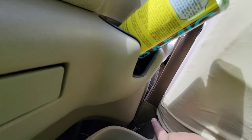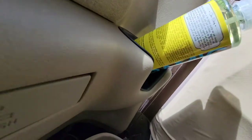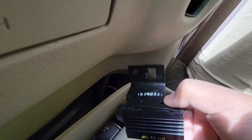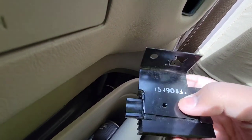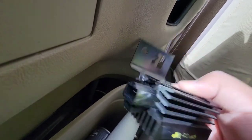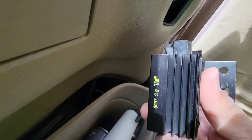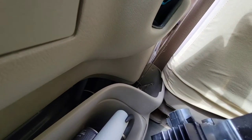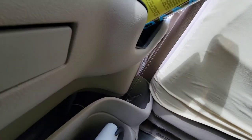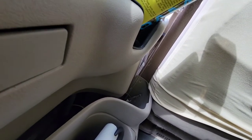You take off the side console — there were two bolts holding it and clips the rest of the way. This is a 10-millimeter bolt; mine was actually a nine. The part number is 15990331 if anybody's asking. This is OEM GM — I bought it on eBay for 35 bucks. Astro van series — please subscribe, comment down below, let me know what you guys think, and I'll see you guys in the next video. Peace out.